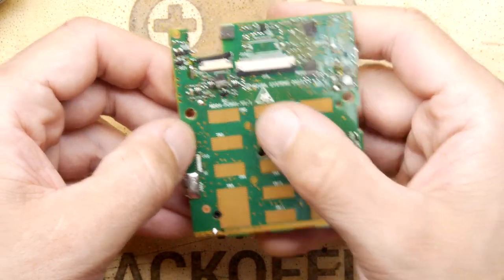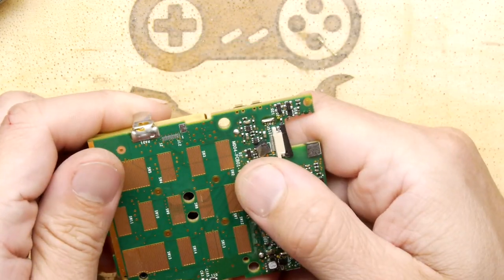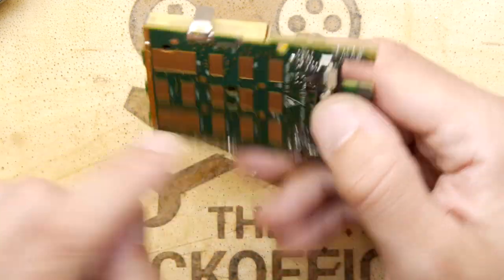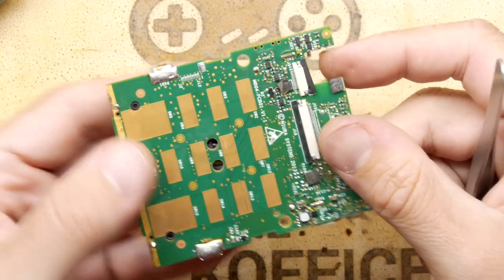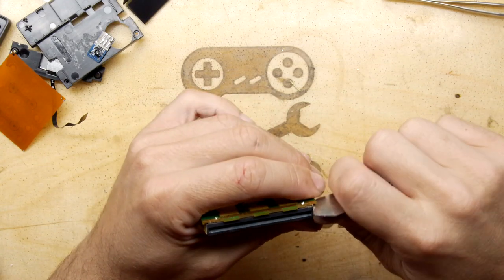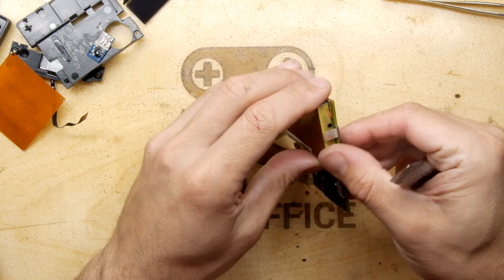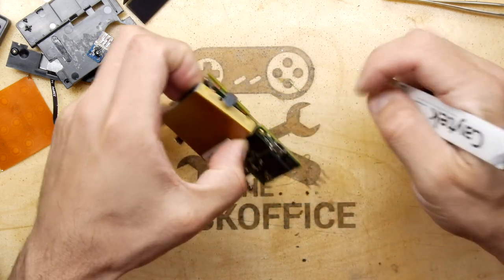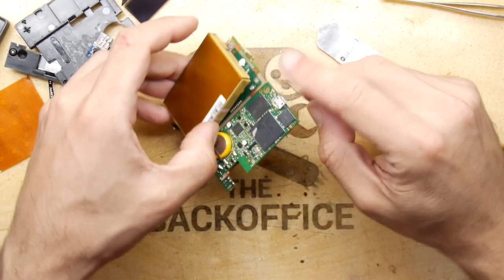So it's a Muro Systems board, and it looks like it would have had a USB connection on this side too — possibly some sort of programming header, actually more pins than USB so it's just a standard header. Now I'm looking on this side because I can definitely see there's mechanism here — this thing is like a Transformer, more than meets the eye. It's lifting a whole layer of PCB with it and doesn't really want to come off — it's clearly glued and trying to lift that substrate of PCB with it. We're going to have to try to get really underneath it, and yes it was connected to the PCB somewhere.